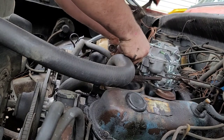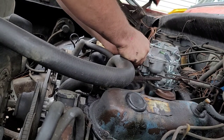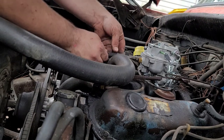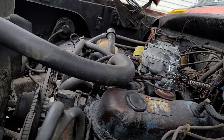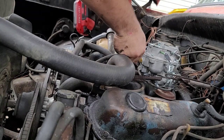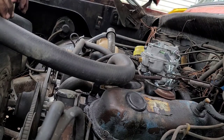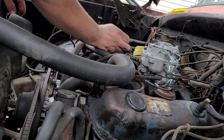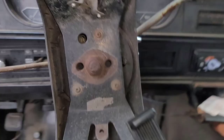Just got to hook up the fuel line and get that done and we'll be ready. Tighten that up — keep that fuel line secure. Now we're going to deal with this vacuum line that really doesn't have a place on the new carb. I'm going to plug this one off for now and see if it runs okay. We should be able to fire it now.